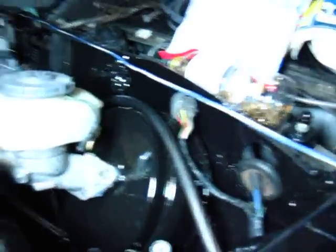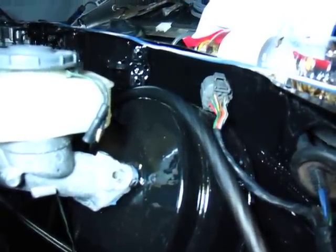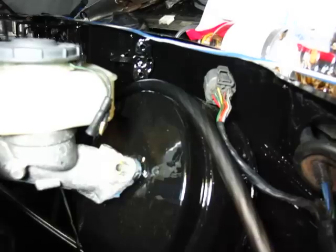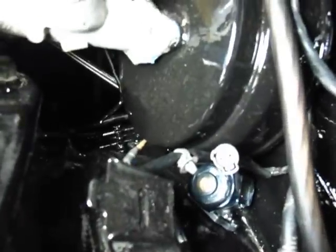I figured out where the main battery cable is going to run. It's going to run right up and over the brake booster like this. There will be a fuse inline, so it's going to come from the battery in the back, come to the distribution block. The fuse line goes from the distribution block straight to the alternator. The distribution block will sit somewhere down here.